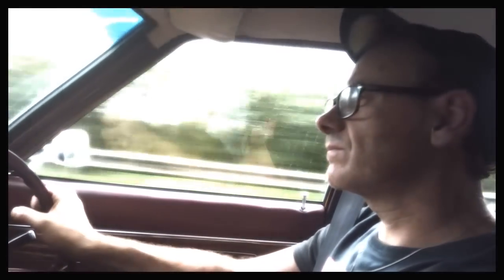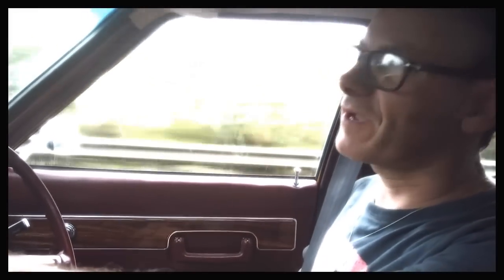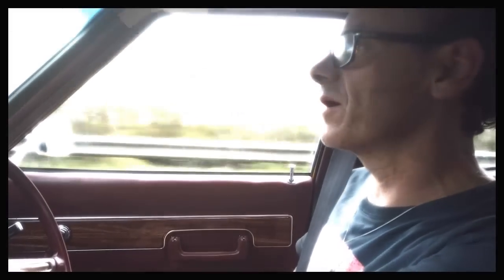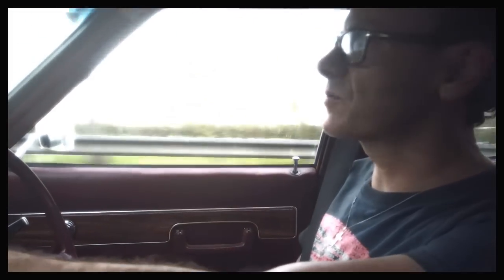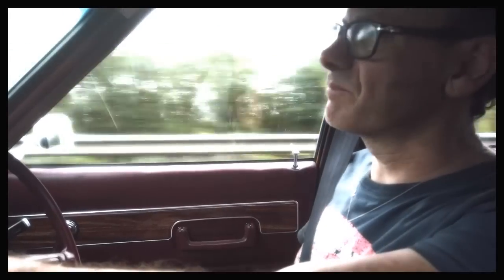That happens all the time on all the gearboxes. So this is the test. We can only do 50 now. But it was a horror show yesterday at 50 on here. It's hard because your imagination starts to tune in on things which probably might have been there anyway, and you can never tell the difference between gearbox whine and axle whine, but it's not mental.